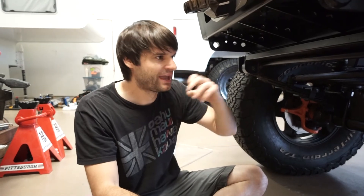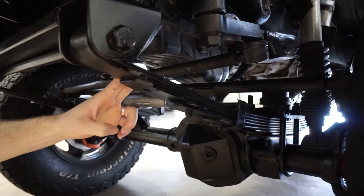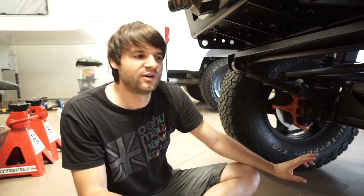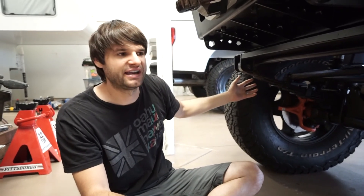The springs are a 4-inch lift made by Sky Manufacturing / Sky Off-Road in Oregon. We chose leaf springs specifically for their simplicity and reliability — we debated a three-link but at the end of the day leaf springs are simple, proven, easy to live with, cheap to replace if needed. The brakes are Wagoneer brakes, which work really well. It's still running the Toyota master cylinder, so with the larger brake calipers you have more pedal throw, but it works fine and holds on the steepest obstacles.